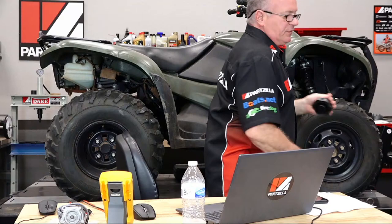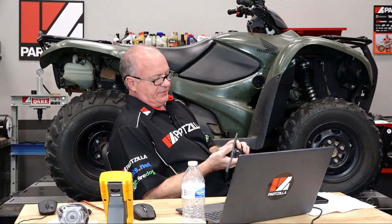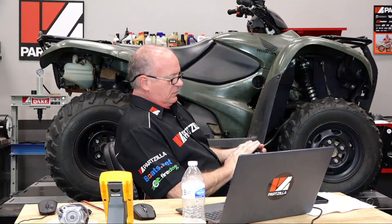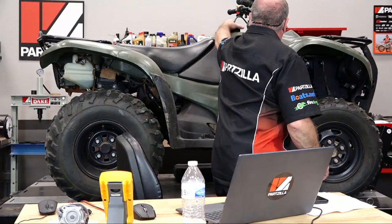there's a check valve inside of here. If it gets stuck, it'll let some fuel pull through out of the tank, but then it creates a vacuum and doesn't let it pull through anymore. So I would say first check, make sure this isn't stopped up, and then you may need to replace your fuel cap itself. So crank it up, unscrew this a little bit, and then see what it does, see if I'm right. But more than likely, you have a stuck check valve in there, probably. Let us know.